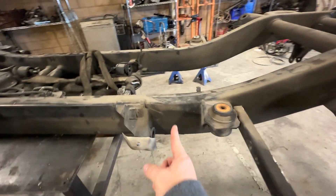We got all the sheet metal basically cleared off. We had to drill out all the spot welds and peel off the top layer of sheet metal. We wanted to have a shelf so that when we attach the old body to the new one, it has something to sit on. It'll also give us more space to line everything up, since these are factory spot welds in this frame connecting to the other one. My battery died so I'll peel the rest off in about another hour. Once these two pieces are mated, it'll give us factory clearance so I can cut the remaining parts to the correct length. Then we'll start meeting up the roof — if you look right here, you can see the ridges, and those will line up perfectly.